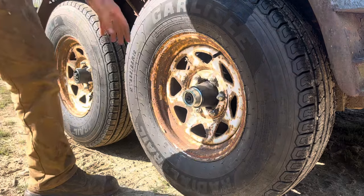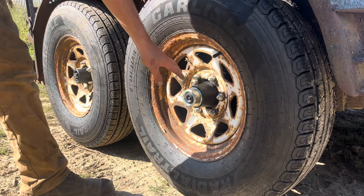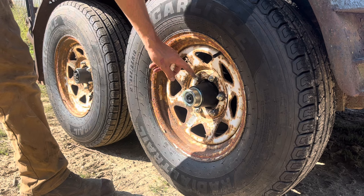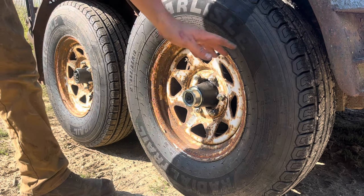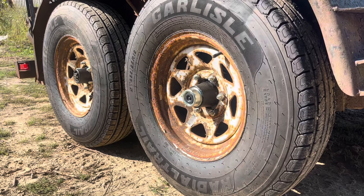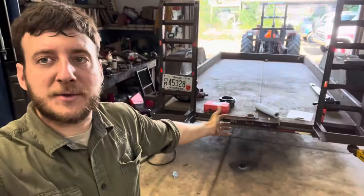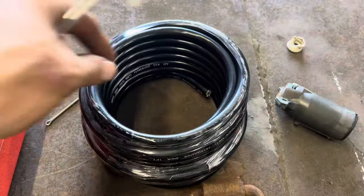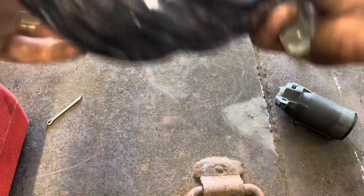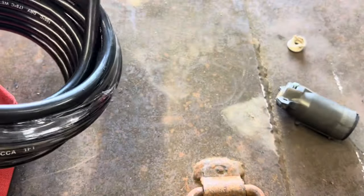It's going to be super important that we torque these down because we cannot guarantee these studs are set properly, so we'll get the torque wrench out when we're done and torque them all. I've got the trailer up in the air — you don't need to do this to make your electronic brakes work; you're likely only going to have to run wires up to the front. I'm redoing all the wiring for this one. Whenever you pull wire, you always want to pull from the inside.